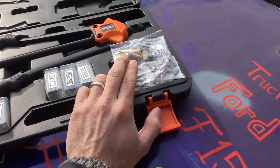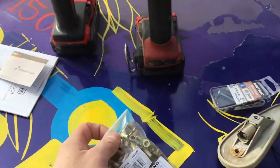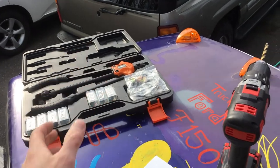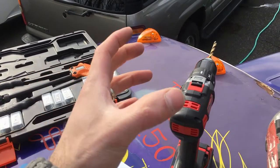There's only five to a pack and to do this job I needed ten. So I practiced on a piece of sheet metal first so you know how far to crimp it. It's not like a typical one where you crimp and it breaks — you go too far with that and you'll actually break the mandrel head and whatnot. So anyway guys, Steve from the Minimasters — thanks for watching.